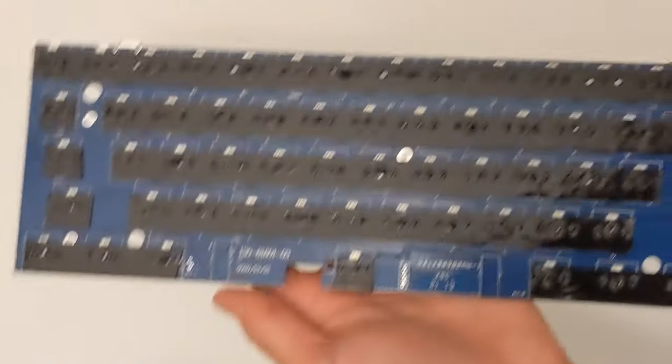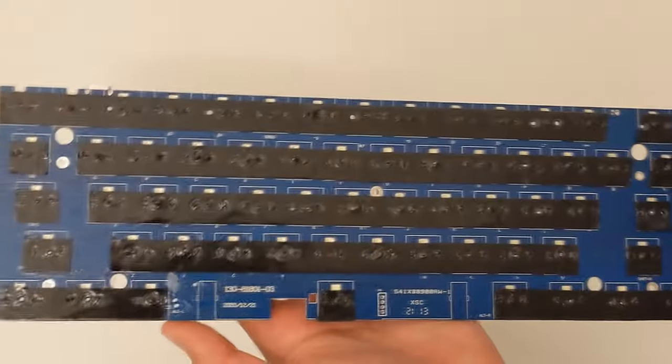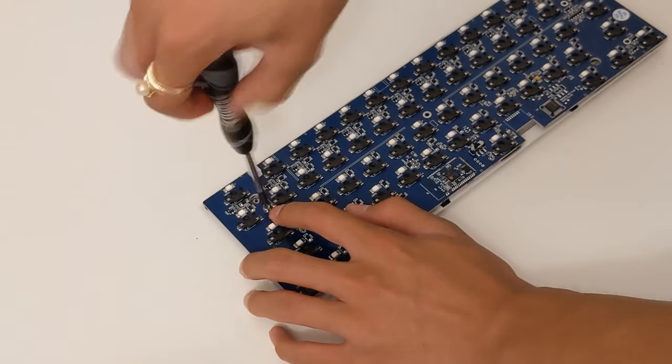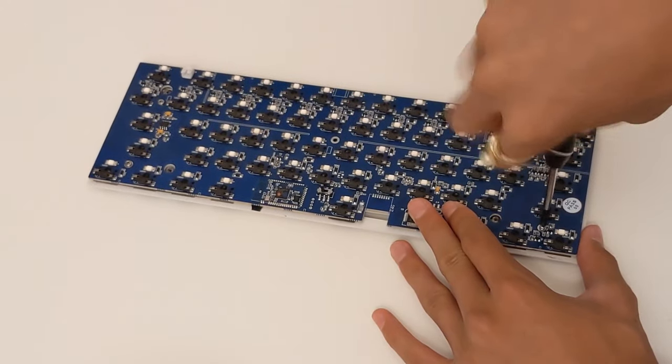If you don't know what the PE foam mod is, I'll leave a link in the description explaining how it works. The only downside of doing this is that once you get the switches in, it's next to impossible to get them back out. I would only recommend doing this if you never plan on taking your switches out of your keyboard again. After screwing the plate and PCB together again, I put the switches and the stabilizers back in.